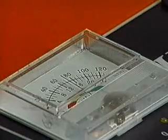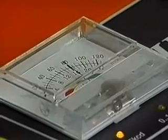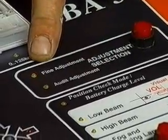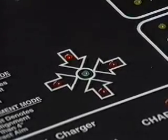The meter during headlamp adjustment measures the intensity of the headlamp and can also detect if adjustment is being made in the correct direction. A rising meter means the right direction; a decreasing meter means the wrong direction. For finer adjustment, press the adjustment selection button to select fine adjustment, a plus or minus one-inch window, and adjust the headlamp in the direction of the arrows until the green light is lit.